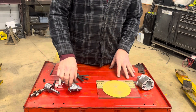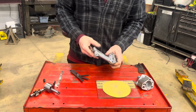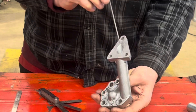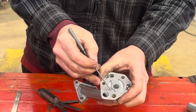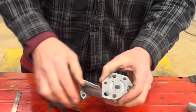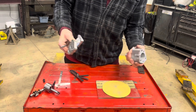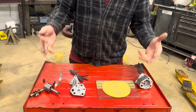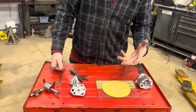A lot of people like to put high volume pumps on. The big thing with the high volume pump is it's the same exact pump, but it's modified — this part here is drilled through to be slightly larger at the end, and it has a passageway milled in it to allow oil to come through on top of the rotor rather than just on the bottom. In my opinion, it's not necessary on the street. You really only need that if you're running high RPM sustained, like in racing applications. There's no real need to do that for street use.